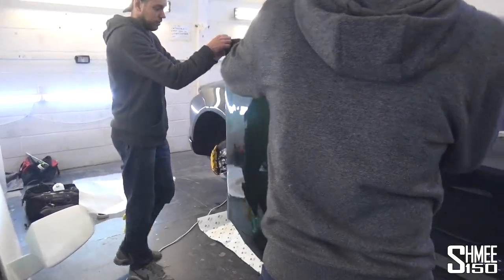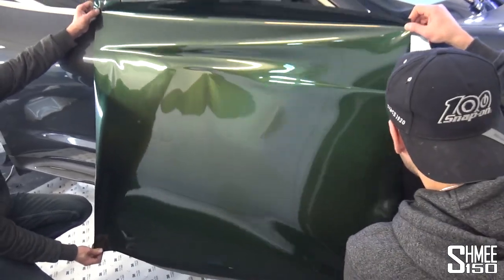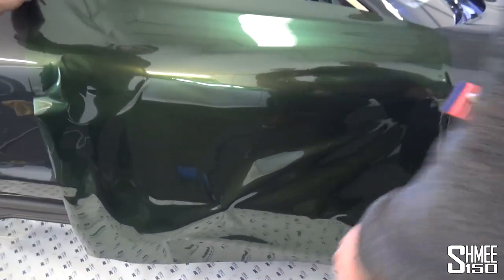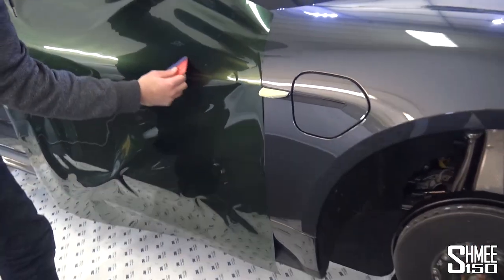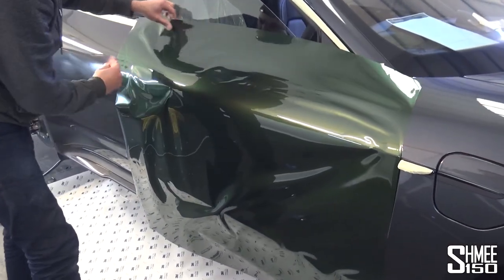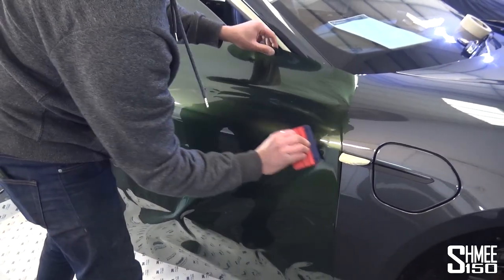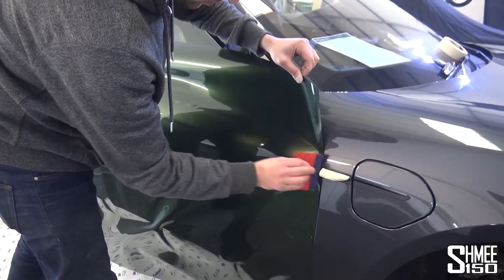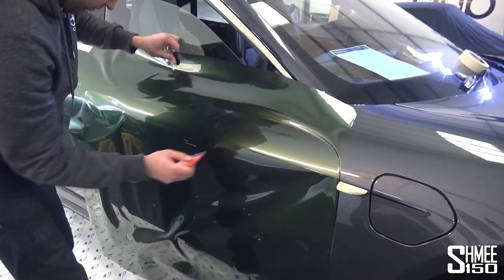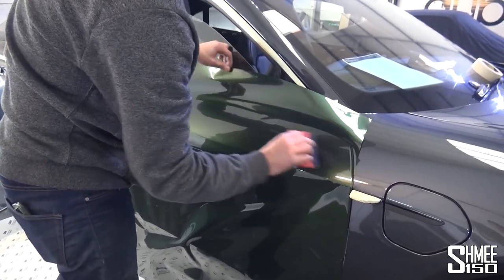Back rolling the material — this is the first step of the car technically going a little bit green. Of course, EV... green... yes — I'm sure that joke had to be made at some point. It's a careful process to make sure it's lined up, particularly with some of the odd shapes this car has. For example, just here there's actually a slight indentation. The material is air release, which means it's slightly easier to remove bubbles. We start work from the main high lines — in this case the shoulder along the car — and we can start to see what this colour will look like. This is actually really thick, which does make it quite hard work to install, but should in theory hide what would be left underneath.